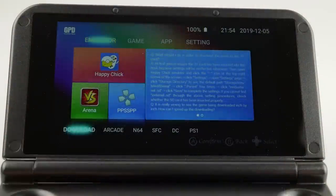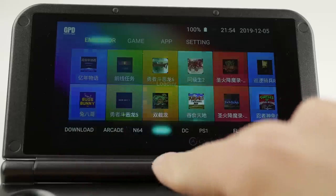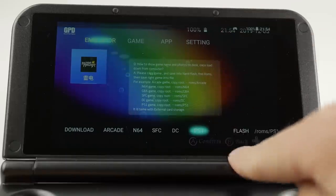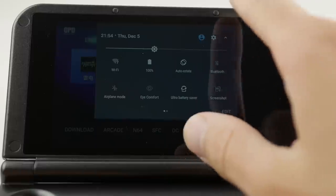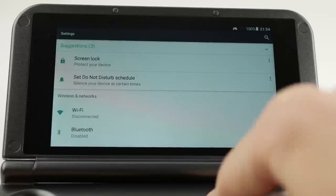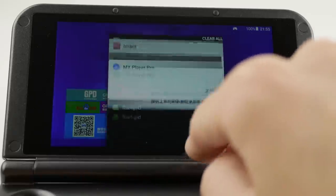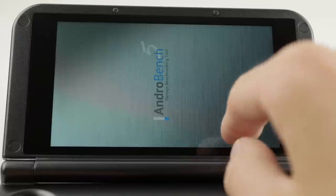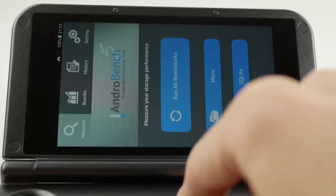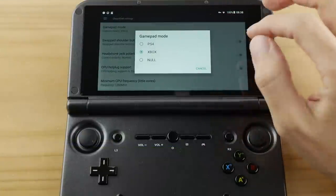I do want to address the fact that your device will not look like mine for the rest of this video because I've already installed the clean ROM for the XD+. The fact that this is still routinely updated by an independent developer is a testament to how supportive people are in the GPD community. I installed it two different ways on two different devices, and now that I have more experience with the MTK platform, I prefer manually backing up select partitions with root and then flashing with SP Flash Tools. The firmware I'm on recently got support for PS4 remote play, which is a pretty cool feature.